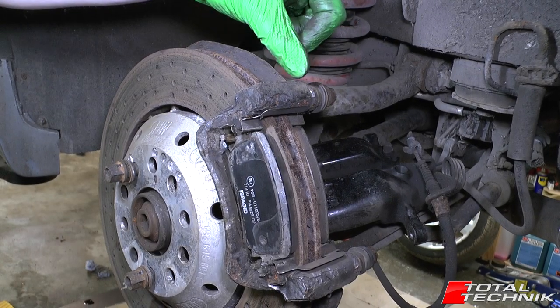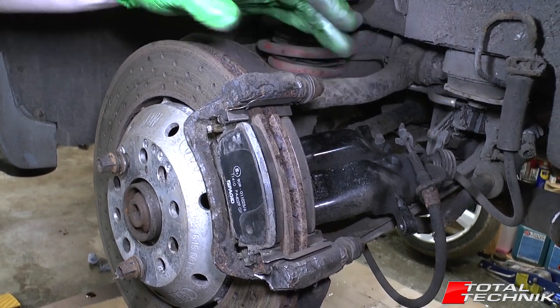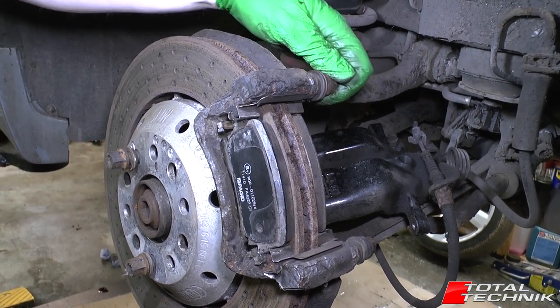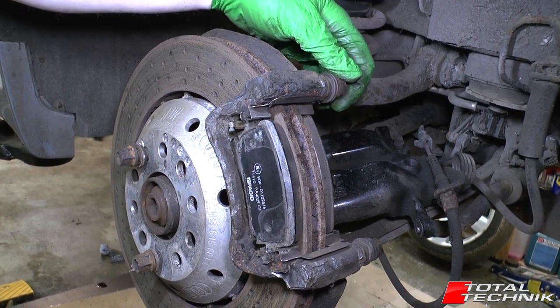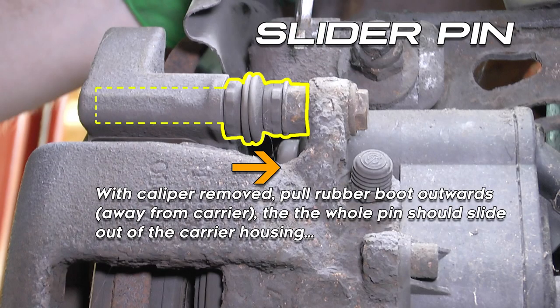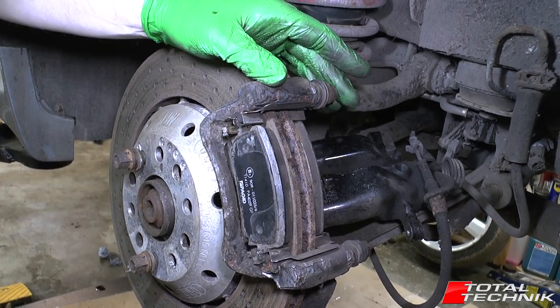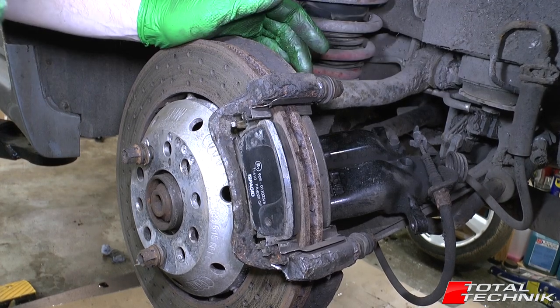Inside the caliper, it's literally just a metal pin. Some brake kits, depending on what you're buying, will come with replacement pins. If you want to, you can remove them and re-grease them — you generally don't have to unless you've got a problem with them. But if you unbolt them, it's just a metal pin, you put some brake grease on there and slide it closed and reassemble. If you've got them in the brake kit, it's worth doing rather than not fitting them.